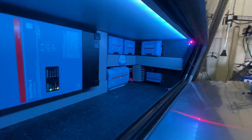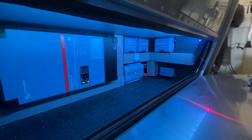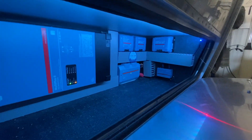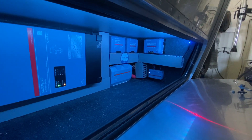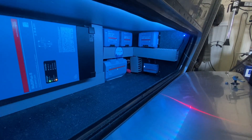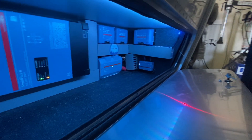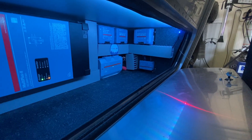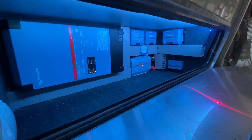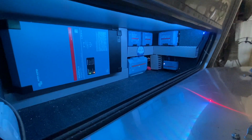I think this looks pretty nice. We did the little LED strip up there again like usual. We've got the Victron Multiplus 3000, the Orion DC-DC charger, the stock Airstream solar controller, an upgraded 100 by 50 controller, a Lynx Distributor with the LED cable, and the Cerbo GX over there as well — all neat and tidy with the three-inch cable raceway. I really like that; I think I'll be using it from now on.